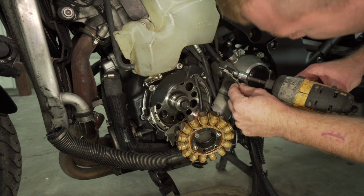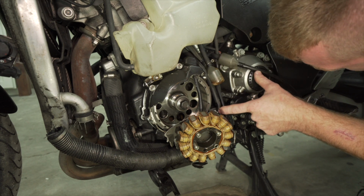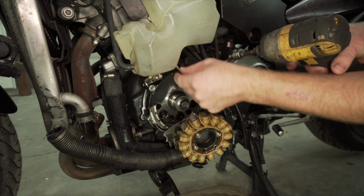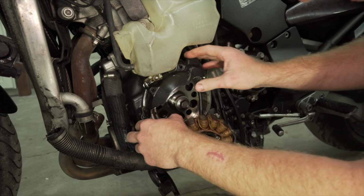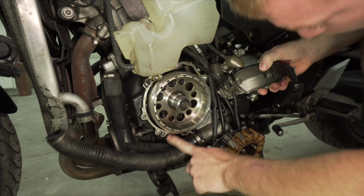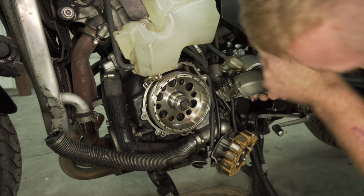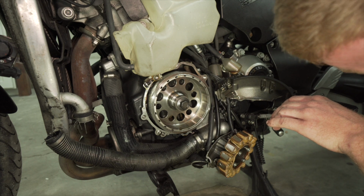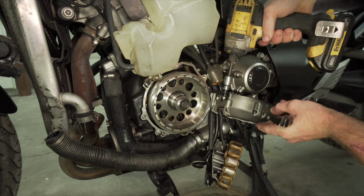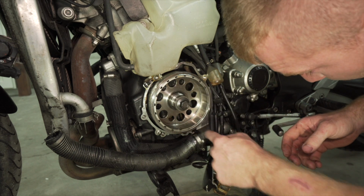Yikes. That is a very bent bolt. Yikes. Looks like part of the case is damaged. Somehow I missed that. That bolt was not damaged. Looks like there's a broken bolt right here. There's a broken bolt right here. And 2 bolt holes that got blown out. So I can drop the motor, weld on these 2 spots, and try to drill and re-tap these. Looks like the flywheel is even damaged partially. So I might need a new flywheel.